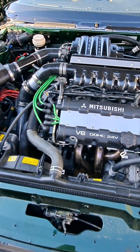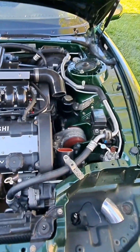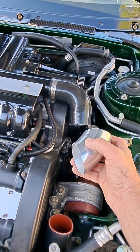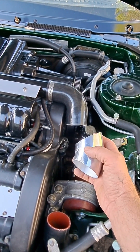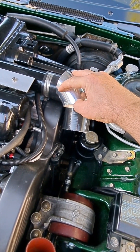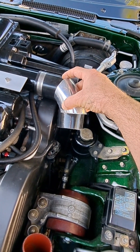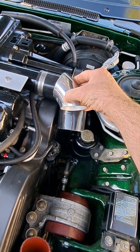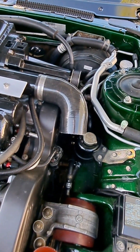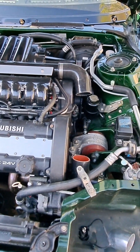I won't have the luxury of fully hard-piping this, but what I ended up doing to work around it is I cut a bunch of pieces from my extra intercooler piping and I'm going to put these inside the boots. I'll flare the ends a little bit so they rest up against the inserted pipe, which will basically fill the void inside all of my 90-degree bends. I'll do the same for the 45s, so when it's under negative pressure these boots won't collapse.